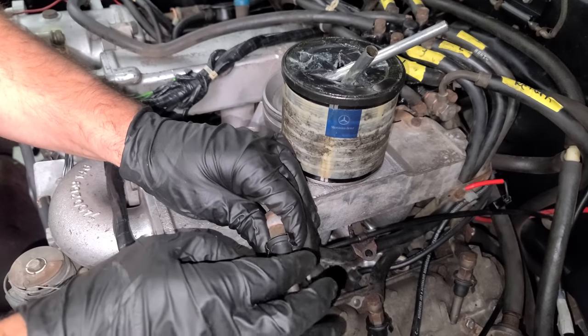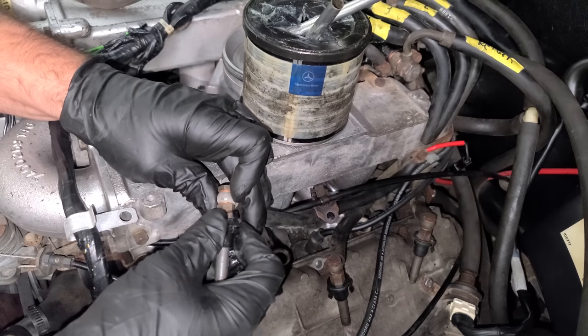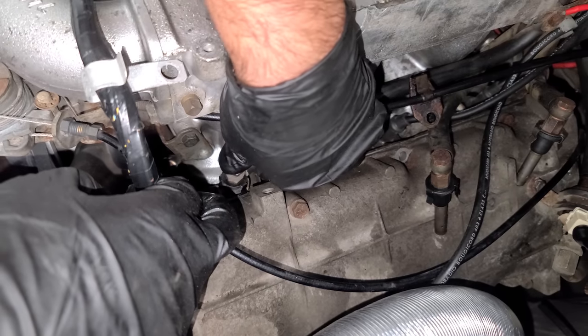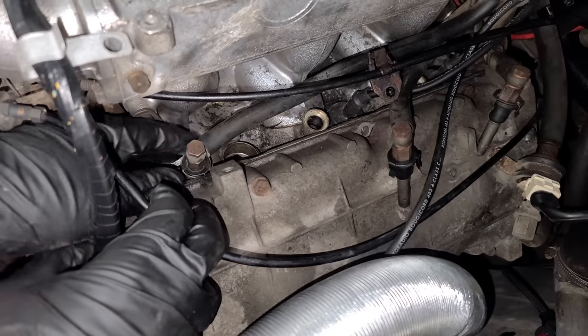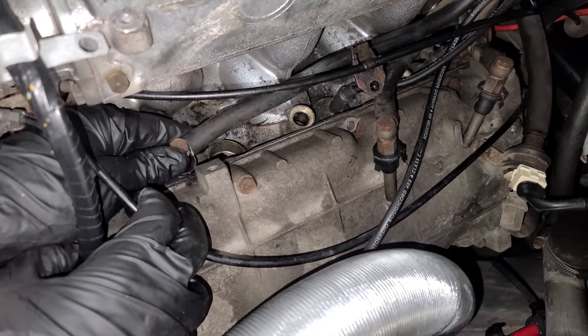Okay. Yeah. Now this Mercedes-Benz sunroof grease also works well. You lubricate rubber seals like this before you put your injector in. So multi-purpose, you can use it to pull arms out of fuel tanks, sunroofs, of course, and DeLorean fuel injector seals. That is very nice. Oh, that's perfect. Oh, there we go. One last clip. Yeah, we're good.